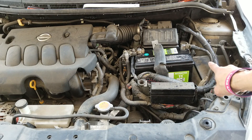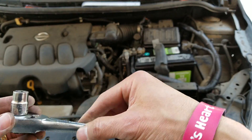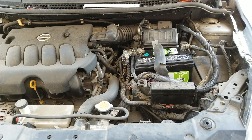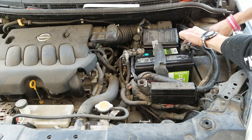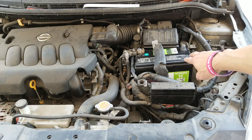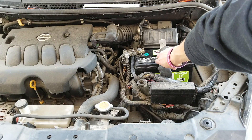Now we're going to remove the battery. Start off on the negative terminal first, and then after that remove the positive terminal with a 10 millimeter socket. If you have a battery tie-down, you want to remove that first. Since I customized this one, I'm going to remove it — it's made out of aluminum.